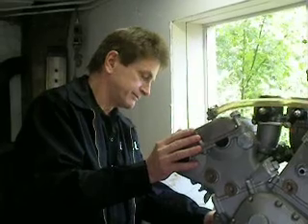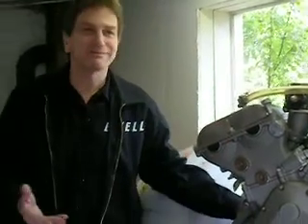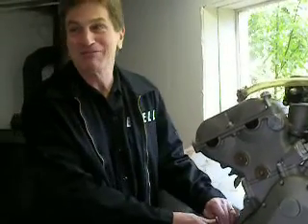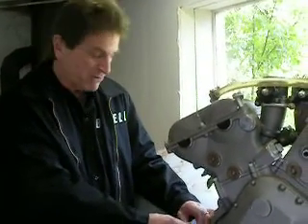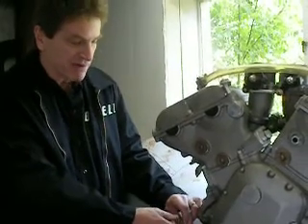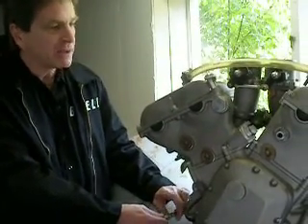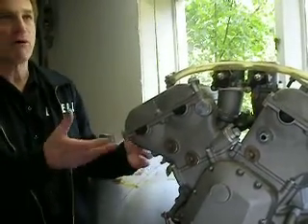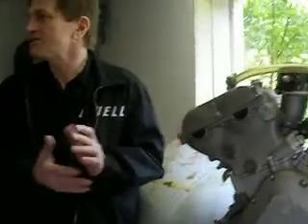This is the initial engine. The power unit is a 60-degree layout. I don't think this one ever made enough power — it blew up on the dyno a number of times. That happens in development stages with every motor; the first few of them just have things that break. They were having problems with the oiling system and things like that. But the bore, stroke, heads, port size, and valves are really the same as the VR.